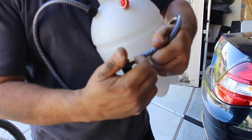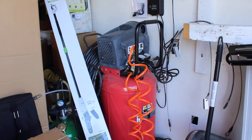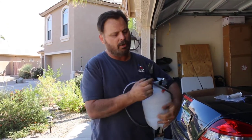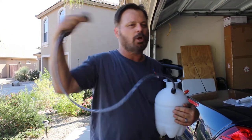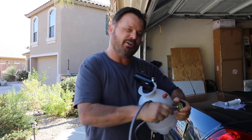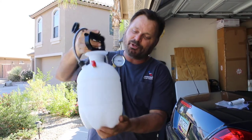In hindsight I could have used my air compressor, but you've got to be able to regulate it down to very low pressure — no more than about 10 to 15 PSI. This reservoir cap is not designed to hold high pressure, so you don't want to blow the cap or the line off. Good luck changing out your brake system fluid and possibly building one of these — it's about a 15-minute build. Bye for now from Avondale, Arizona.